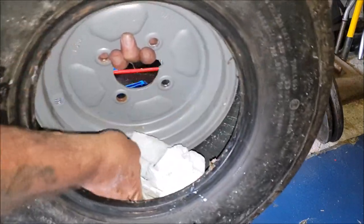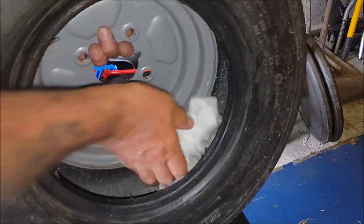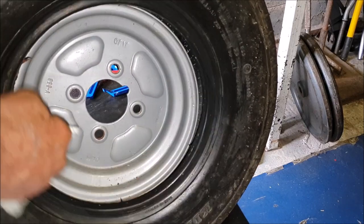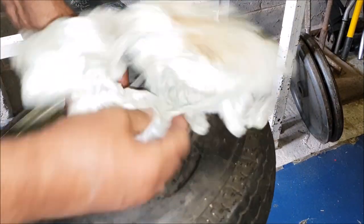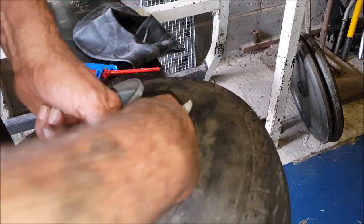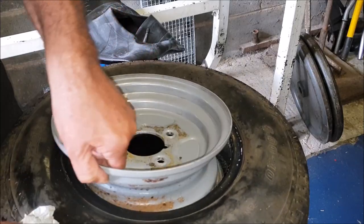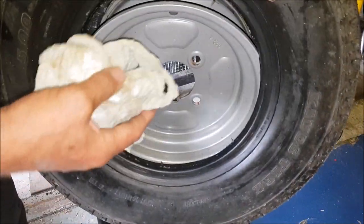If it is illegal, tell me, because I don't know. It might not even be a puncture — it could be that the rim around here is not sealing properly. So I'm going to wipe it pretty clean, go all the way around, clean the rim. I might put a bit of tape around here — you can see this rust — where the inner tube is going to sit, because you don't want that. You could use duct tape or masking tape.